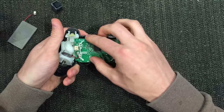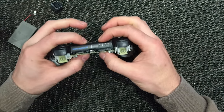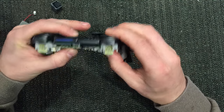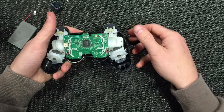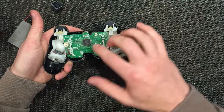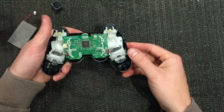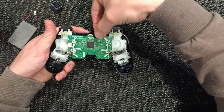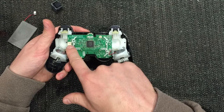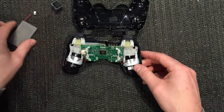Just feel the pressure on that - yeah there's a little bit more pressure on that. It's a really poor design. I don't like it as a design but it is what it is. We've only got one screw down here and I guess the case itself helps to clamp it down, but really it should have had screws up in there to give it nice even downward pressure. I wouldn't have even used that type of ribbon - I would have used a slot-in type ribbon or a different cable mechanism altogether, something more reliable like a clip-in system.